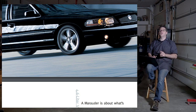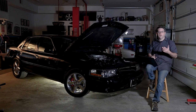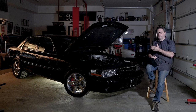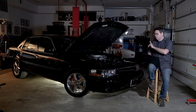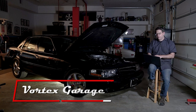The Marauder is a little bit of a different beast. For production models, they used a 4.6 liter 32-valve V8 making 302 horsepower — basically a derivative of the InTech 32-valve V8 first seen in the Lincoln Mark 8. There's a detuned version in the front-wheel-drive Lincoln Continental. The basic architecture of this motor can also be found in the Mach 1 Mustang of the era — the stick-shift Mach 1s had an eight-bolt crank, whereas these have a six-bolt crank. Importantly, this wasn't supercharged from the factory and was built as a higher-compression naturally aspirated 32-valve V8.